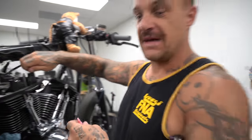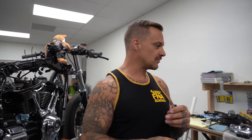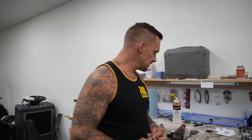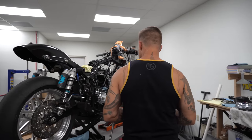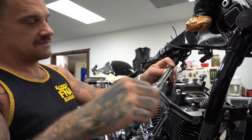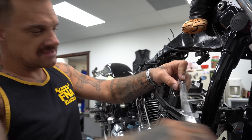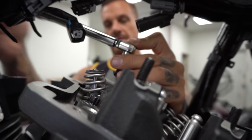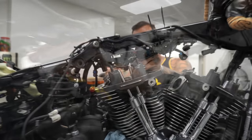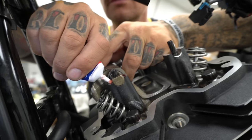All right, these things torque to 5 foot-pounds, which I don't have a torque wrench that I would trust at. That would be the bottom of the torque wrench range, and you want to stay in the middle of the reading to keep it more accurate. So I'm going to convert that to inch pounds, which is 60 inch pounds. That's what I'm going to torque these to. Pretty solid. This is a 5/16 bolt, so that is going to torque this more, I think, is why they torque this so light. Generous amounts of lubricant on everything.